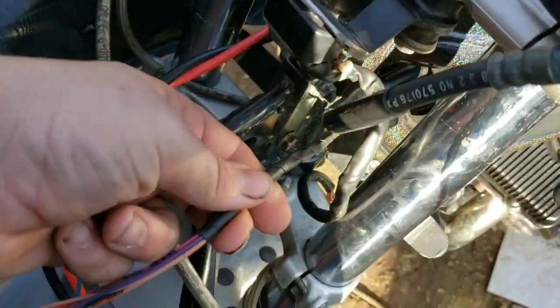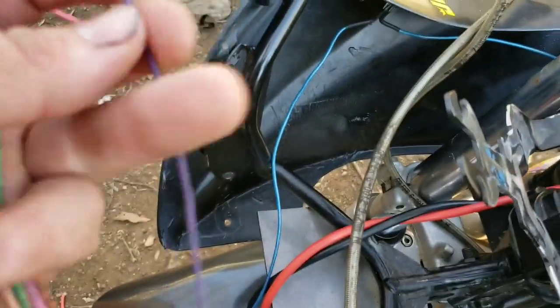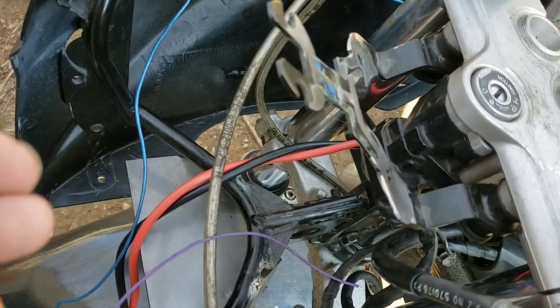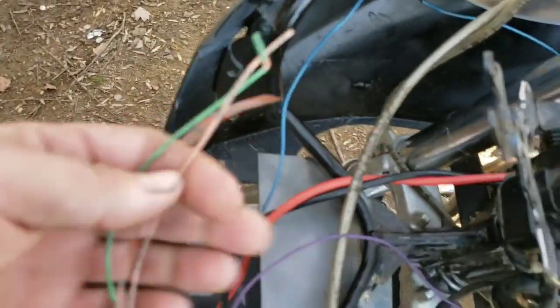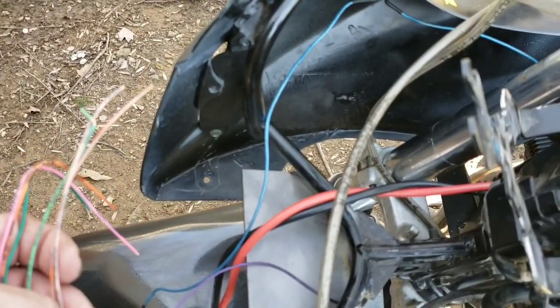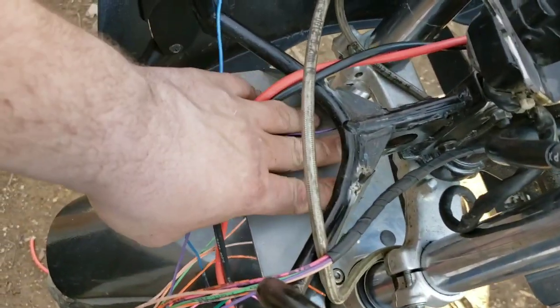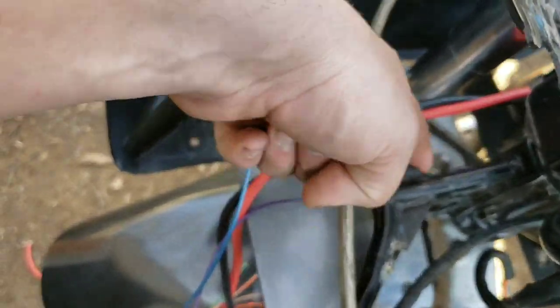No, that is not electrical tape, actually. That is cold shrink, and it is amazing stuff. These are all of our switches. So let's see, this is our flex, so this will go to the clutch switch. There's a lot of them. 2 of these are ignition. And then we've got nitrous control, auto shift, and then the main power relay will be right here. The battery will sit on here in a battery box of its own, foam seated in against there, and that'll just have a zip tie going over top to here to lock it in.